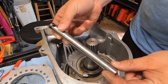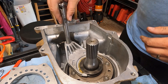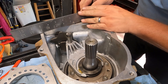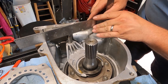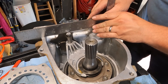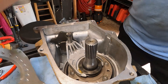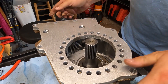Alright, so I got it cut down, ground smooth, took off the burrs, and it's cooled down. This should slide into place — good. Let's do a little check: get the straight edge out, just run it across — look at that, perfect. Just barely riding on it. If it gets caught on it there, then you've got an issue — it's not going to press down and seal all the way. So now that that's in place, let's put this on and do a test run.